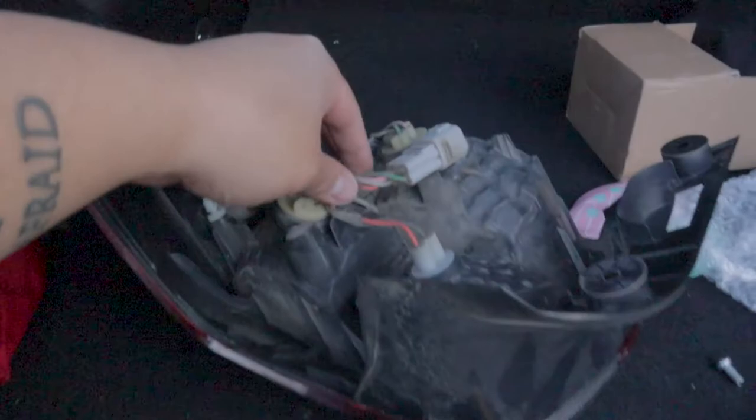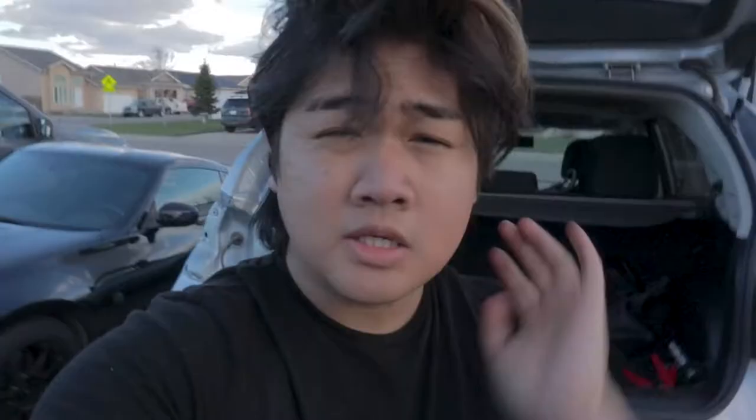Here's the game plan: we've got the taillight out and we're just going to tap those wires. Before you route the wires up to the taillights, I recommend wrapping them with electrical tape or anything that protects the wires, because they're susceptible to breaking from environmental elements like ice, salt, dirt, pebbles, and rocks. You want to make sure they're protected with a wire sleeve or electrical tape.